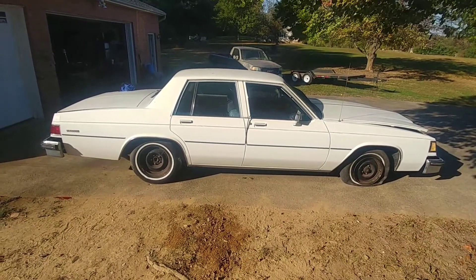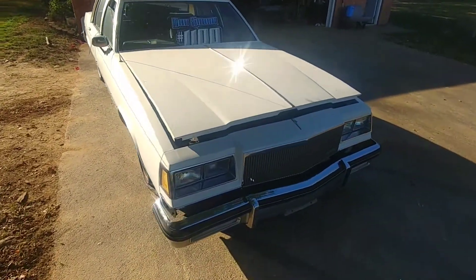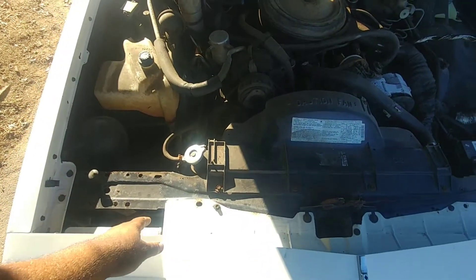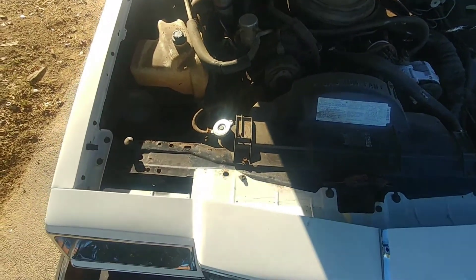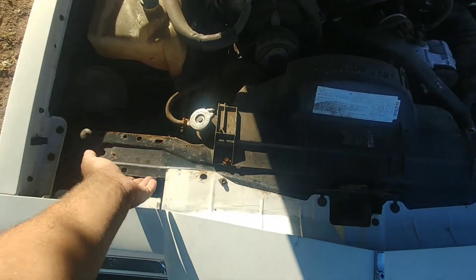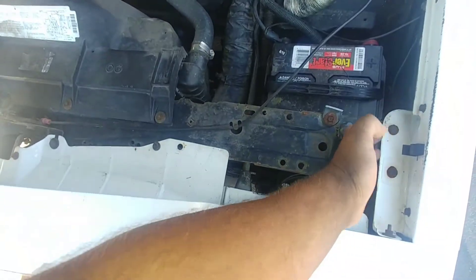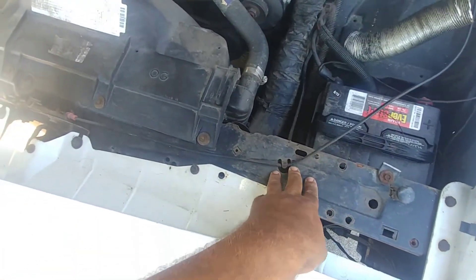What I'm gonna do underneath the hood of this car is something different. I'm gonna get some all-thread and fit it up here on the front core support and weld it in, and take it all the way down to the frame. This way, when I get hit in the frame or in the front, it'll push in a little bit but it ain't gonna budge. I'm probably gonna do some welding on these fenders, weld them to the front core support, and put some all-thread on this side too.